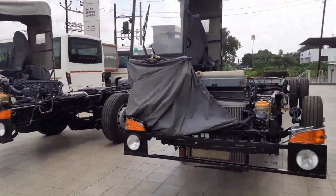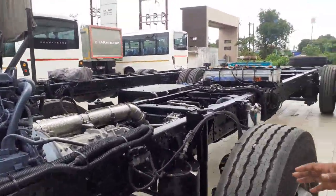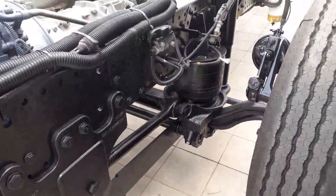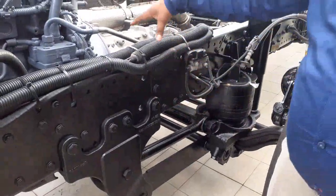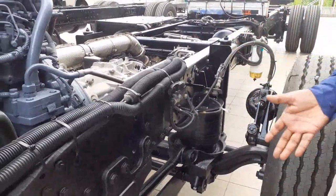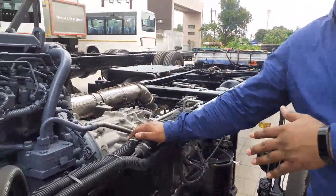We are looking at the two chassis of 1624. On the front side you will get two bellows with an anti-roll bar, and on the rear side you will get four bellows with an anti-roll bar. This suspension is specially designed on this chassis where the suspension goes below the chassis — it's not an aftermarket fitment. It is designed to take the loads and isolate the road vibrations from the passenger.